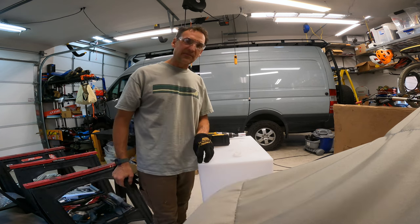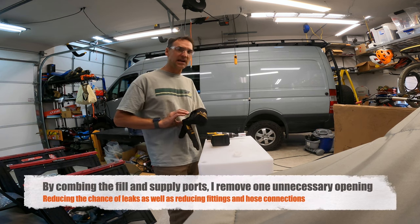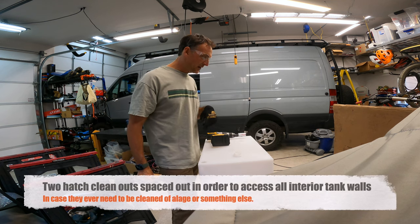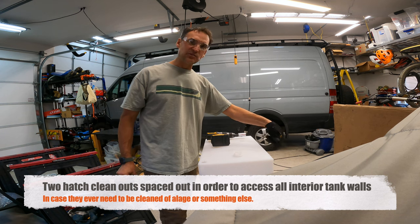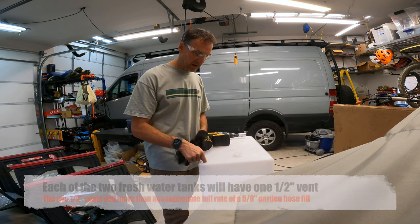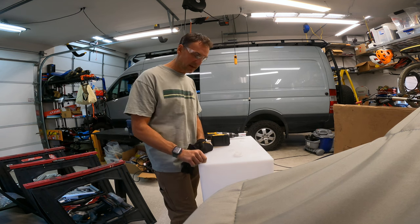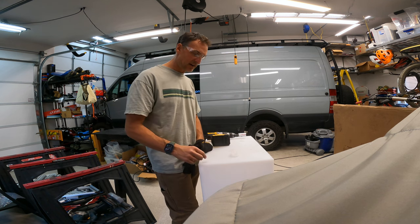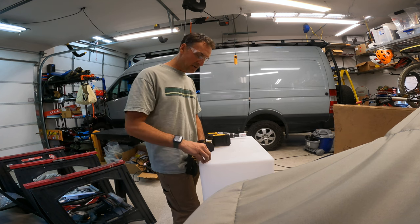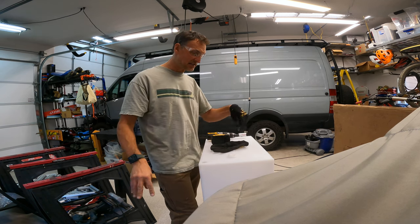Before I finish this tank, I'm also going to put in my supply — the water that's going to come out. It's also going to be my supply in, and they could be combined. It doesn't matter if you fill from the top or the bottom of the tank; it's all physically the same. I'm going to put two hatch cleanouts on the top and a vent on the top. That'll only be a half inch because I'll have two tanks combined from one shore power fill. That five eighths inch garden hose fill will get split over two half inch fills, or I could do three quarter inch since I have a three quarter inch fitting. I'm only doing a half inch fill and half inch supply for everything, but the three quarter inch fitting actually allows it to get ever so slightly lower to the bottom of the tank. So I can get just ever so slightly more water out, and I'm going to need those half inch fittings for some other uses for the gray water tank vents and the vents for these two supply tanks.